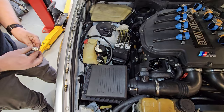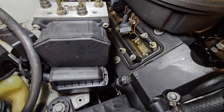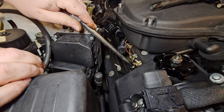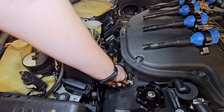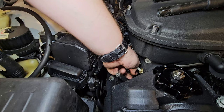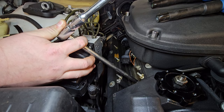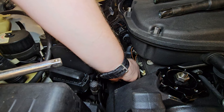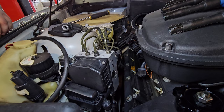So now we're going to put eight of them back in — Laser Platinum. I'm going to drop this guy in there. You really can just drop them in. I always try to drop them in slowly so they don't bend the nodes, depending on the plug, angle, and engine. These are pretty stout so I don't worry about them. And of course we are not using an impact — I have seen people do that and it's a bad day. I'm just using a wrench extension so you can feel how much torque you're putting on. You're not trying to put 1,500 foot-pounds on them. The torque spec is like 23 newton meters — it's pretty much just snug. I went a little more than a quarter turn. These have a crush washer on them, so you do have to compress the crush washer when they're new.